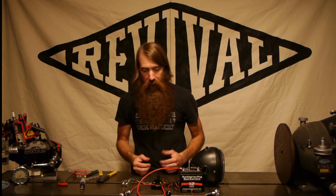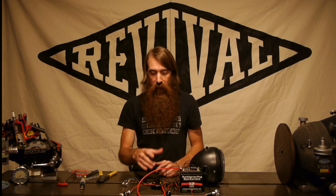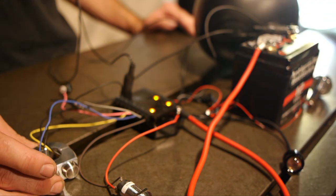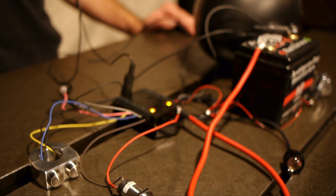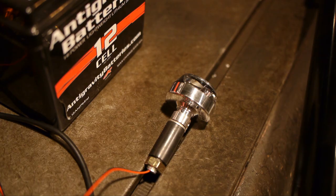Turn the key on — the lights race around, then the auxiliary output comes on. The auxiliary output is where you connect your ignition system, and potentially a field-excited charging system wire. Since this is just a demonstration, nothing has happened other than the M unit turning on. To turn on the headlight, tap the button connected to the blue wire — headlight turns on. Press it briefly to switch to high beam. Press again to turn it off. Pressing the yellow wire button confirms the turn signal is working perfectly.